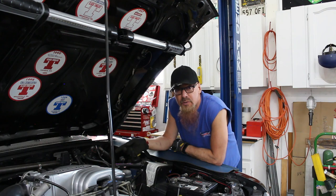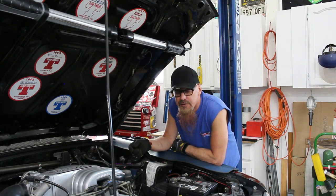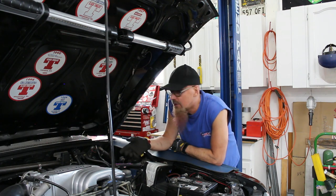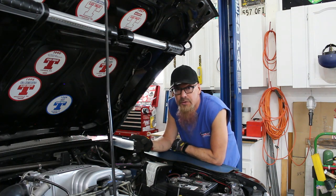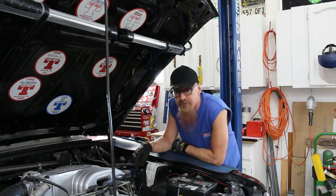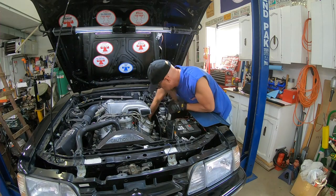If you were paying attention when we were underneath the car, you'll notice the transmission and the clutch are out, because it seems like with this car, they're usually out. I might have to pull off the flywheel and the block saver and the starter on the passenger side before I can get that header out. It's certainly not going to go out the bottom. There's not enough room that way, but if we're lucky, it might come out the top. We'll see. Let's get after this side first.